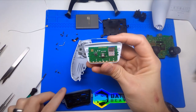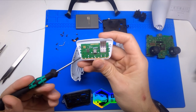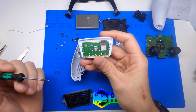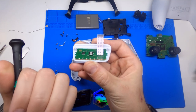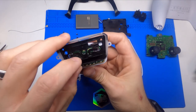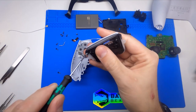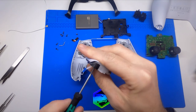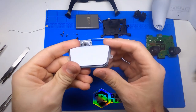This will come right off and expose our touch pad. Different from the DualShock 4 — on the DS4 the touch pad button, the actual click, was on the board itself, and then the touch pad worked as the device that pressed that button. Here it's reversed. At the bottom we have five LEDs which push straight into that diffuser from the bottom. Going off how Sony normally does things, I'm going to assume those are full RGB LEDs and that the surround around the touch pad will change colors based on what player you are or any other indicators within the game. Since it is a diffused plastic, it won't be blinding you at night.